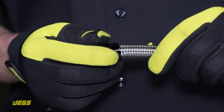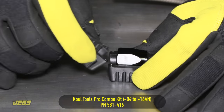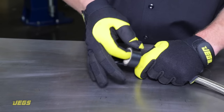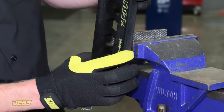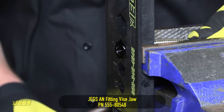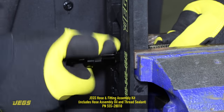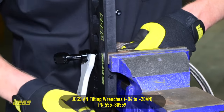Disassemble the fittings and slide the sleeve over the end of the braided hose. While this can be done by hand with a little care and patience, the CoolTools fitting assembly tool is a good investment if you'll be building a lot of custom hoses, as it makes assembly quick and painless. It's helpful to mark the hose just below the sleeve with some tape so that you can visibly confirm the hose remains seated in the fitting while you assemble it. With the hose end fully seated in the sleeve, clamp the sleeve securely in a bench vise using jaw protectors, which are made specifically for assembling hoses — the nylon material grips the fitting securely without damaging the finish. Using an appropriate assembly lubricant, push the other half of the fitting into the hose and sleeve while turning so that the threads engage the inside of the hose. Using the correct size aluminum AN wrench to protect the finish, continue screwing the fitting together until it is completely assembled.